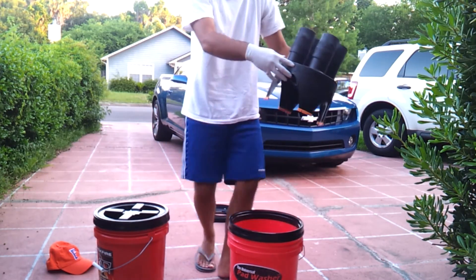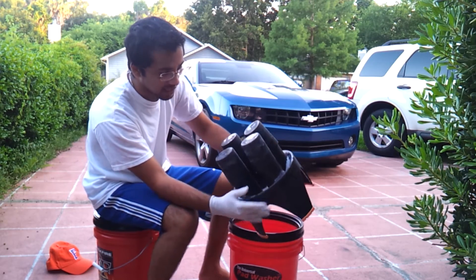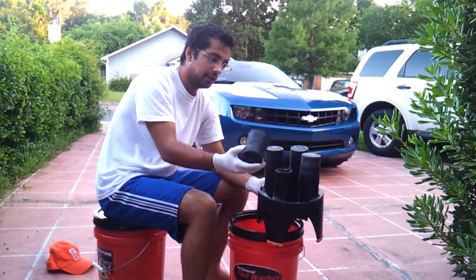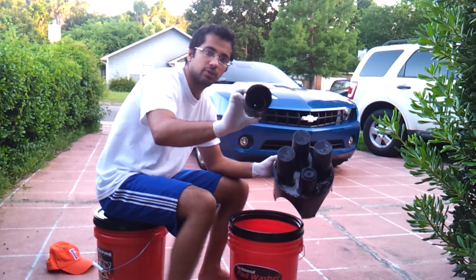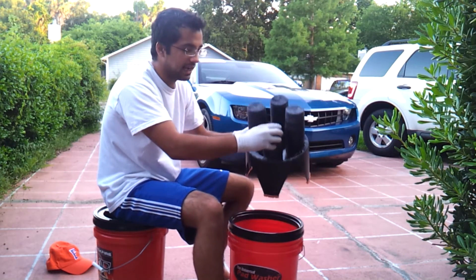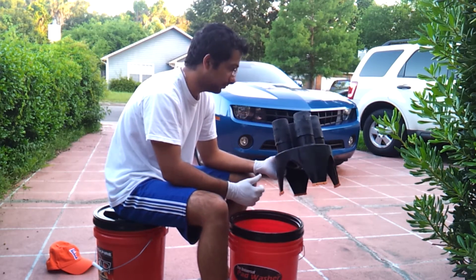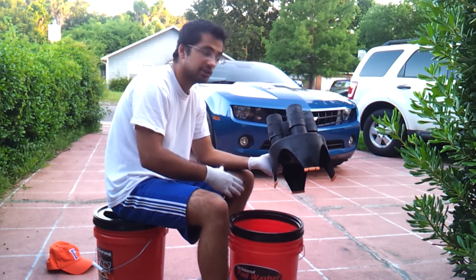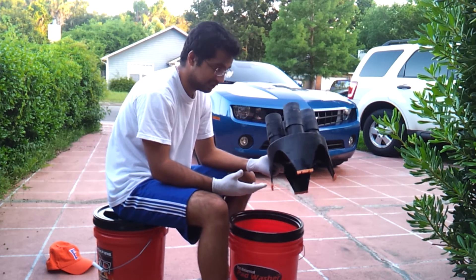So this is the crux, the main part of this thing, and as you can see there's a lot of polishing dust inside — it's kind of gross. There's this little hole right here and what looks like a little spring at the bottom. What's happening is as you push down, water — or whatever solution is in here — shoots out, and that coupled with the buffer spinning the pad across the grit guard on top of this thing is what causes the pad cleaning system to work.